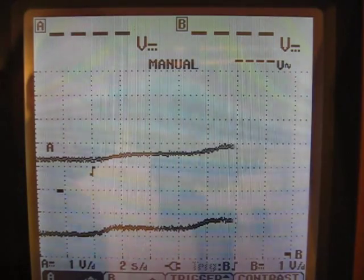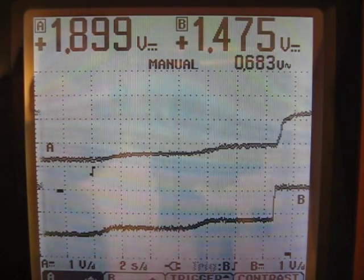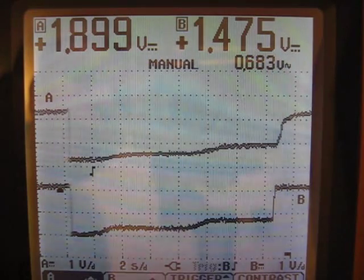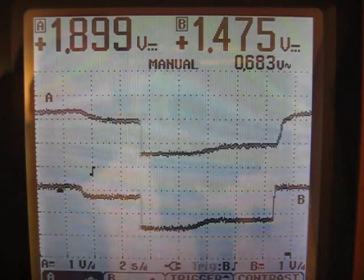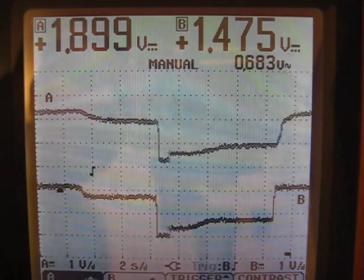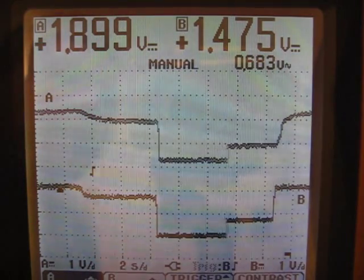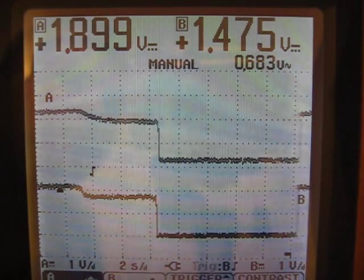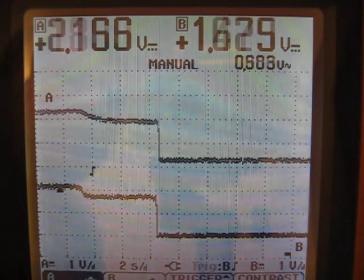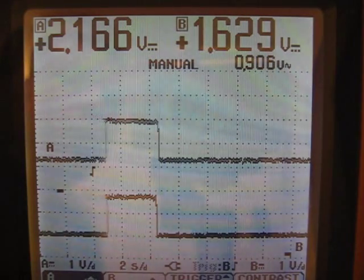As you can see it's lagging behind and increasing very slowly, but if I twist fast it goes up and it's smooth. Now as the trace comes back around I'm going to drop this down a little bit. You'll see it comes back down quick, but if I snap the throttle off it will snap off too. There's about a 120 millisecond delay from the time I let off the throttle until it actually snaps completely off.